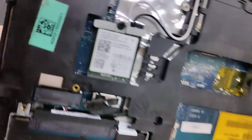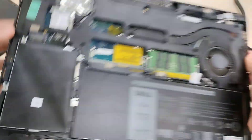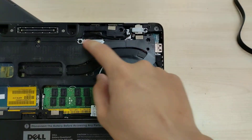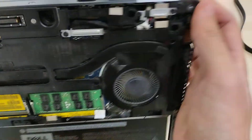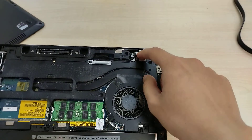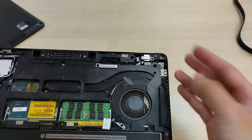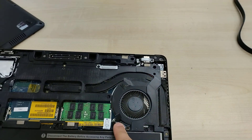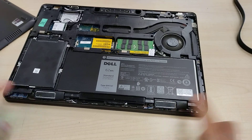This has an Intel wireless card inside currently. The display cable comes through here and plugs in here. The charging port is probably modular — that's the part that can be replaced. The USB ports are soldered, so if they wear out you will need to do some soldering. The battery can be disconnected relatively easily over there, and the dual speakers are here.